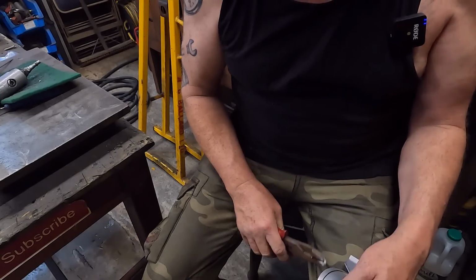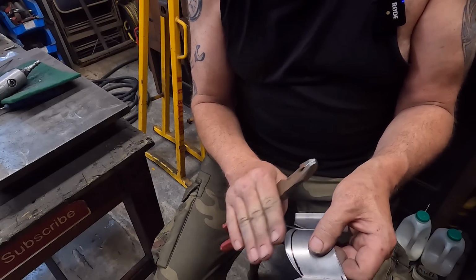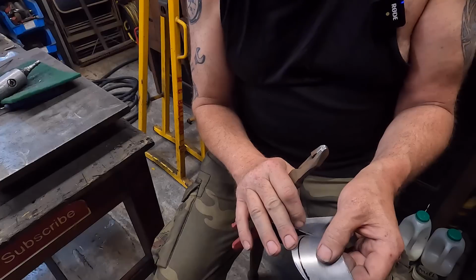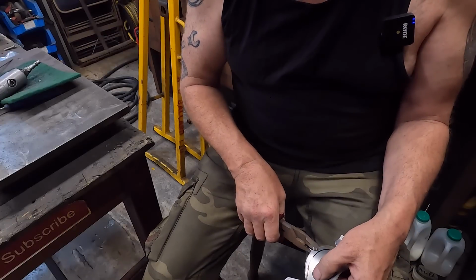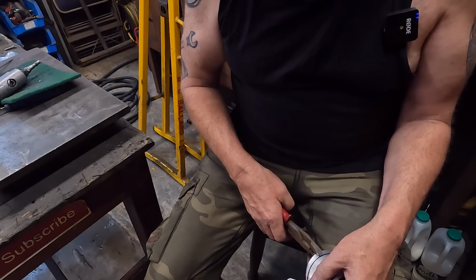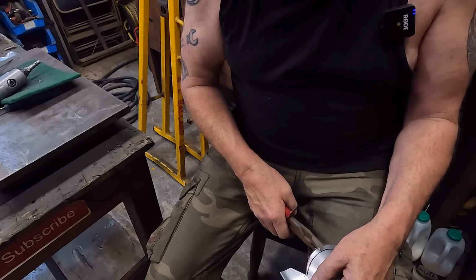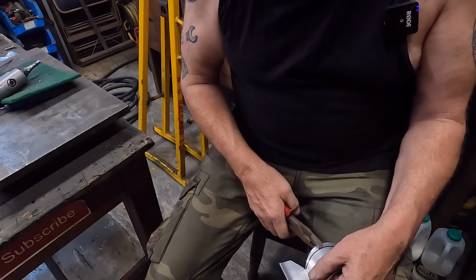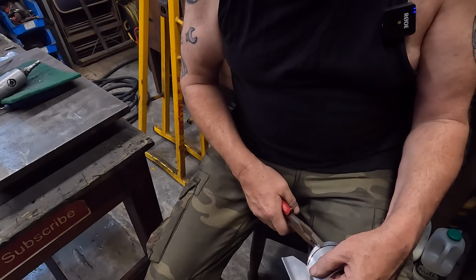Alright, start in the middle. I want to roll this round a lot more so in the middle, then sort of tapering off up to the edge. Now you will end up, if you do try something like this, with scars in this, but the material's thick enough to dress them out.